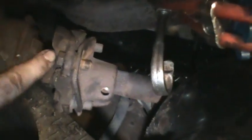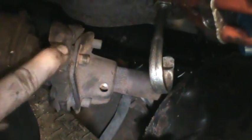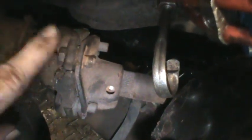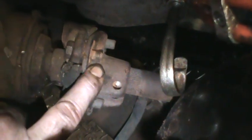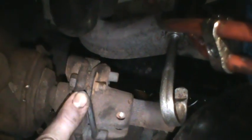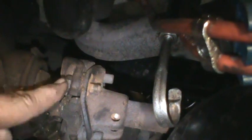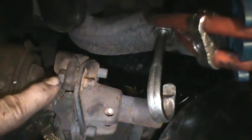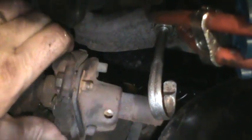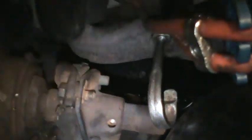All the nuts are off and it should come apart in one of those three places when I try to pull the steering column out. This bolt on the rag joint — there are two of them, one on each side. It takes a half-inch wrench on one side and a nine-sixteenths socket on the other side; they are both six-point so you can use any socket you have. It appears this bolt is permanently attached to the steering coupler, but it's useful to have two wrenches to prevent it from rotating.